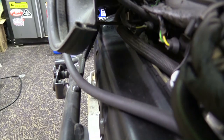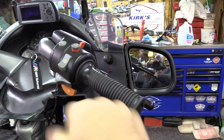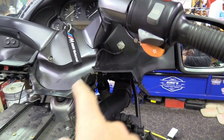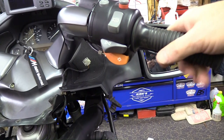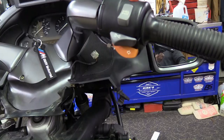That's designed so that if you grab onto the throttle and throttle down, it will kick the cruise control off so it won't be fighting you. A lot of times your cruise control will be knocked out by that switch on that side of the bike, and many times you can fix it by just loosening up your throttle cables just a little bit. You don't need a lot of slop in there, but you want it good enough so that every time you hit a bump and something jiggles, it's not knocking that thing out.